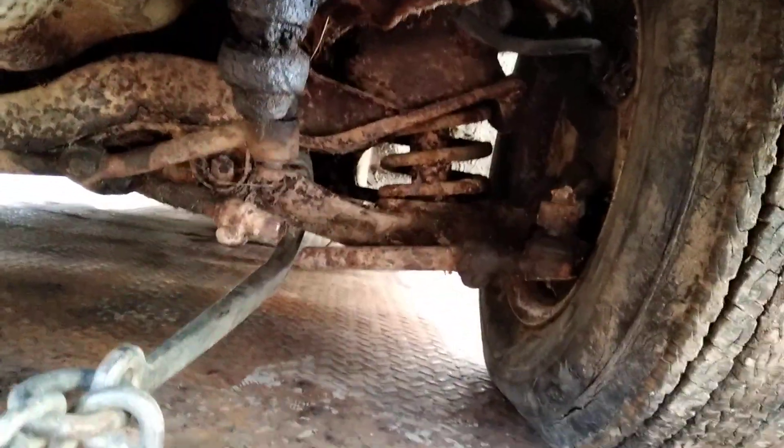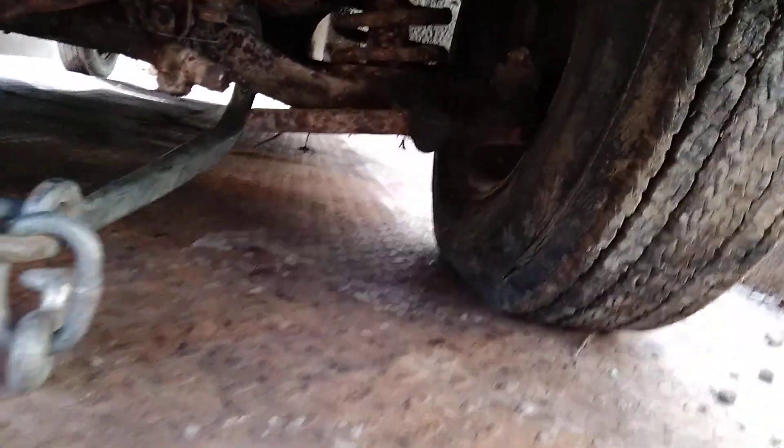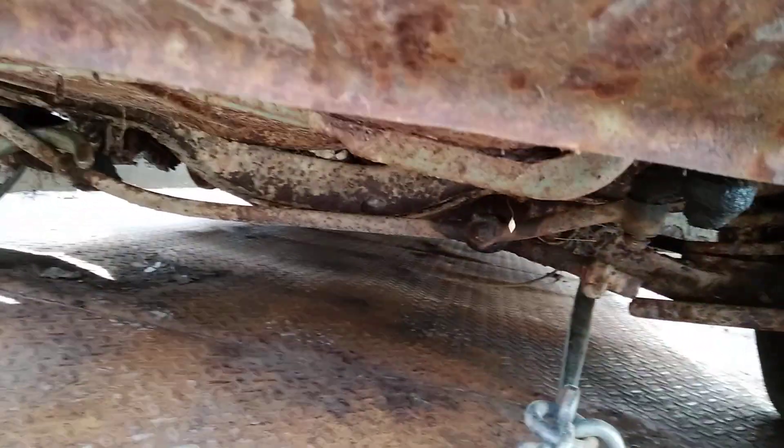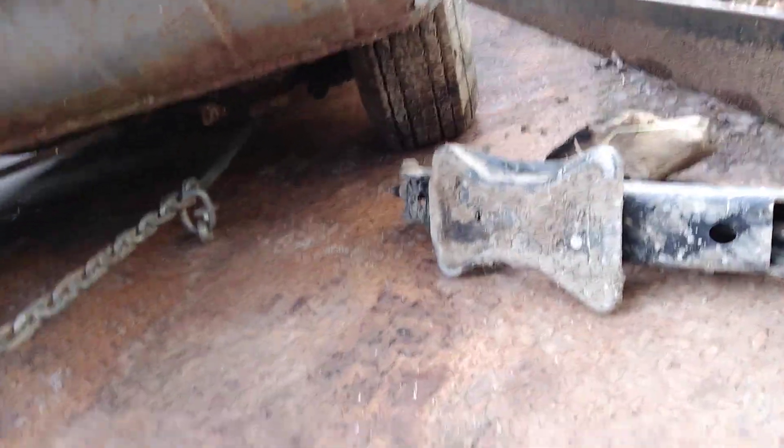Get my leg over it. I'm trying to get it close enough just so I can move it around right there. And it's not actually the tie rod that's broke — it's a little sleeve thing that goes around there, rusted in half. I think that's bent there. I'm gonna look at the other one, but I don't think I can actually get inside this one.